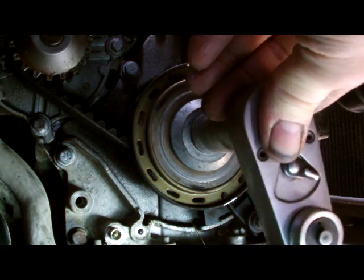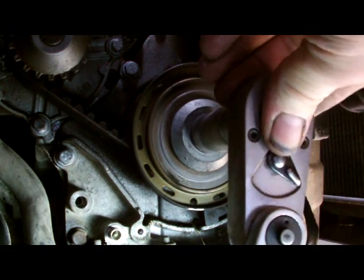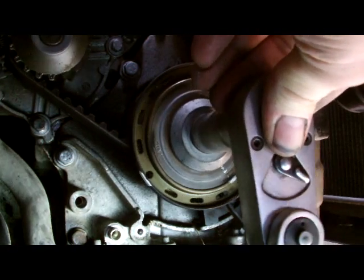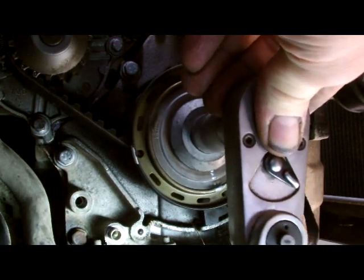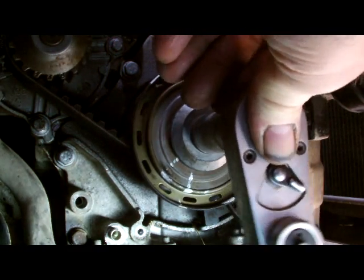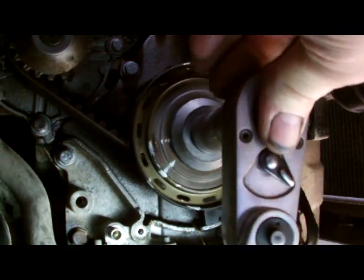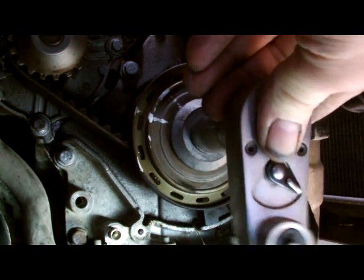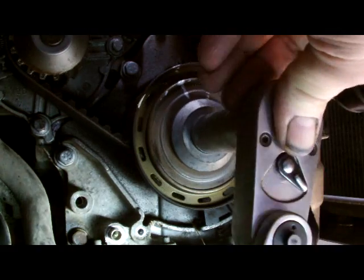And disconnect the battery when you're doing the timing belt operation in any car. Key out, disconnect the battery for safety. So we'll crank her 6 times, and then we'll recheck our time marks, and then we can assemble up the covers again. This one's done.